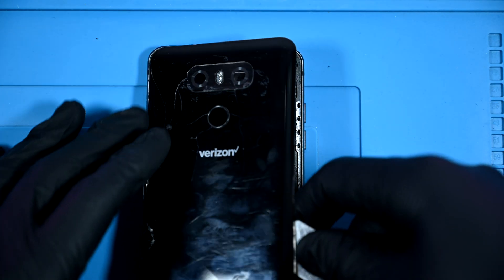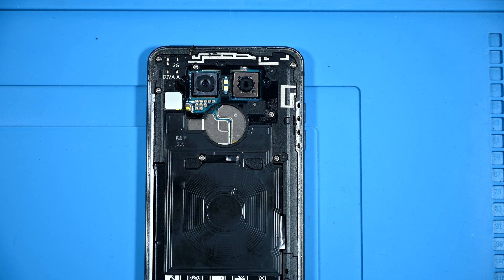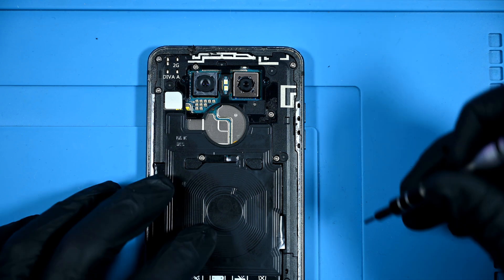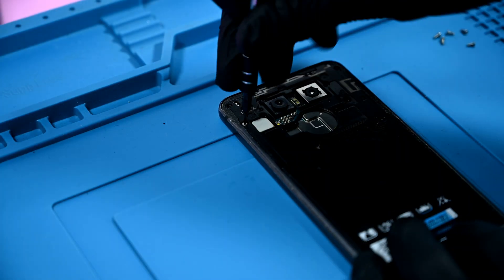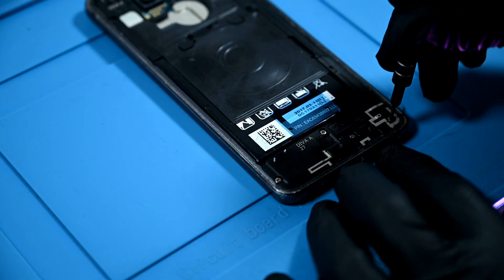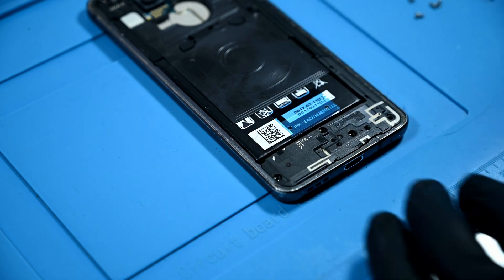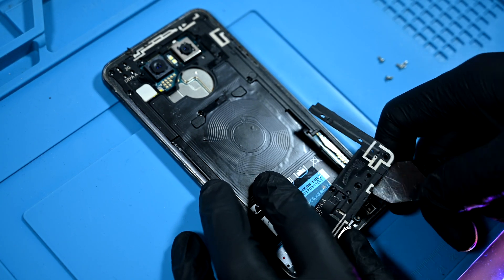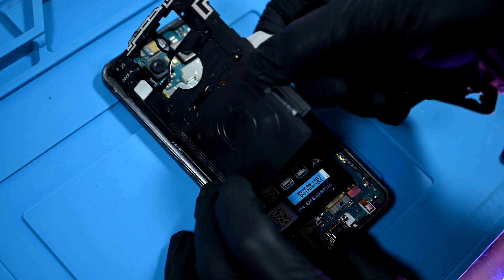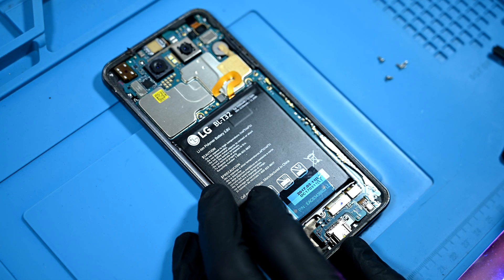This one has been opened before to check for functionality, so I've left the back glass separated. This isn't a repair guide by any means. Up top are seven Phillips screws that need to be removed. The antenna board likely won't be used in the final product — it's incredibly boring looking. Down below are four more screws. Even though this one contains the main loudspeaker for the phone, I'm going for design over function here.